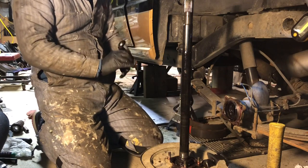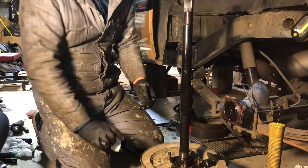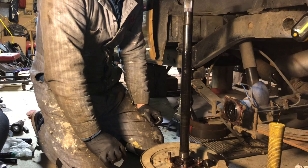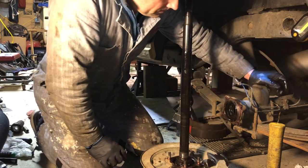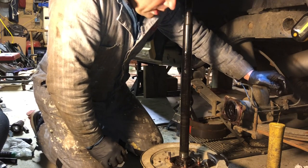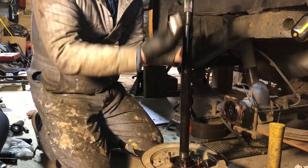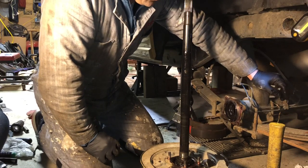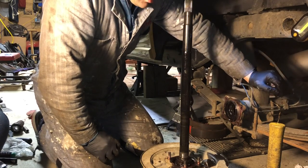As a side note, be careful with the dust around your brakes when you're taking them apart. Never use compressed air to blow that dust around. It's cancer causing, especially the older asbestos stuff. But even any dust is not good to breathe, even if it's not asbestos. So definitely wear a mask if it's gonna blow around, but don't even bang on it very hard to get that dust up in the air. I mean, unless you're a big fan of lung cancer in 20 years. If you're a big fan of 20 years from today's date getting some lung cancer, then go for it.